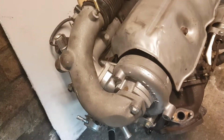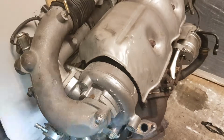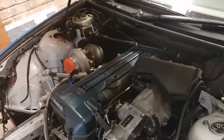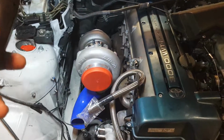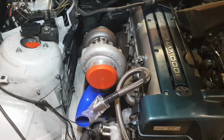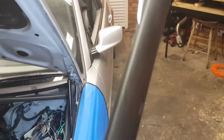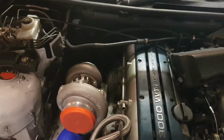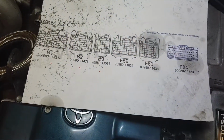From my research, I see people get a maximum of about 400 horsepower out of the twins sequentially, but it's also stated that the lifespan is shortened by that. This is a much smaller turbine. This should be like a GT35 spec, but it's not. It's really just a journal bearing eBay turbine. The GT45 on the NA is capable of much more horsepower, although it's also not an authentic GT ball bearing turbo.